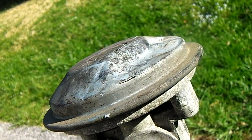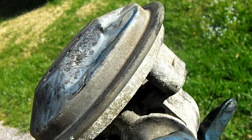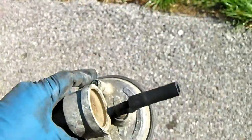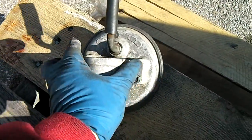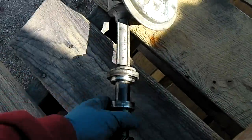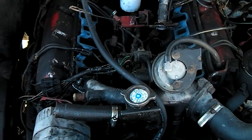Right here it's cracked. I'm not certain, but I suspect that may be why it doesn't work. At any rate, these two bolts can come out and this head is replaceable, so you don't have to buy the whole assembly. If your shaft is good, you don't have to buy that.